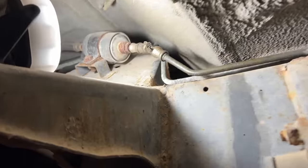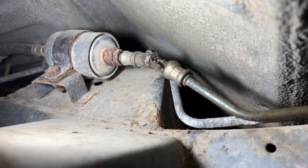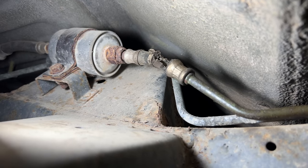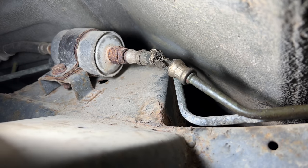If you remember from last time, I discovered that this hose after the fuel filter was eaten by mice. The fuel filter unscrews from the hoses, but the hoses are a permanent part of that pipe. So my plan is to cut the ends of the pipes off and then use normal hoses with hose clamps and install a different filter in place.